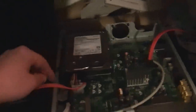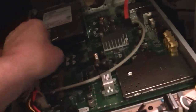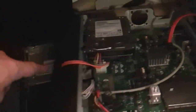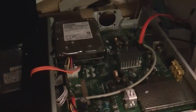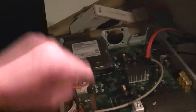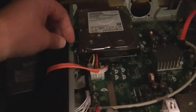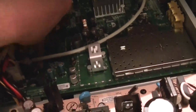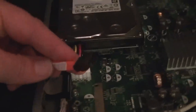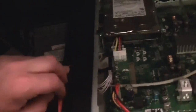We're going to go ahead and remove this disk. This is the SATA cable — this secondary cable going to the disk drive. If you're trying to do this with a laptop it's probably still doable, but you might have a tougher time compared to a desktop like this. Okay, that SATA cable is unplugged — that's the secondary drive in this machine, unplugged now.